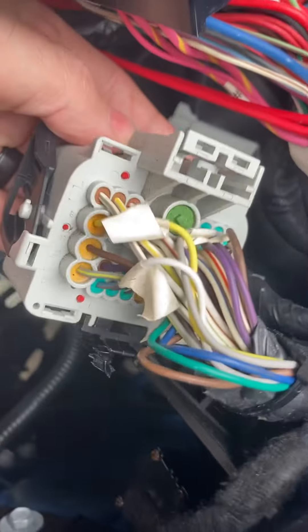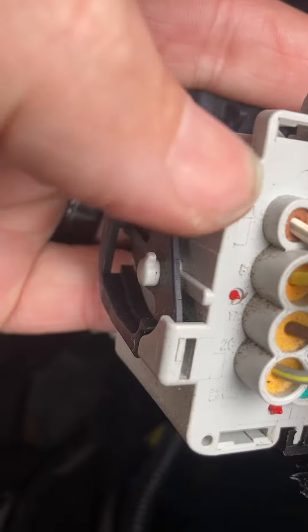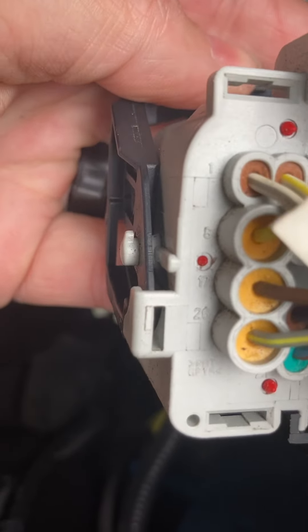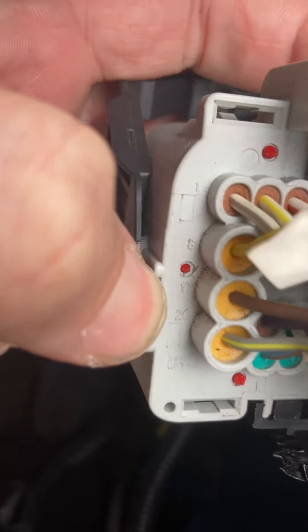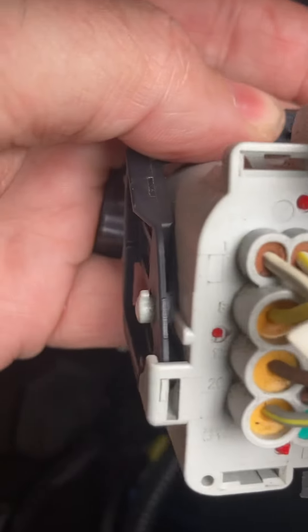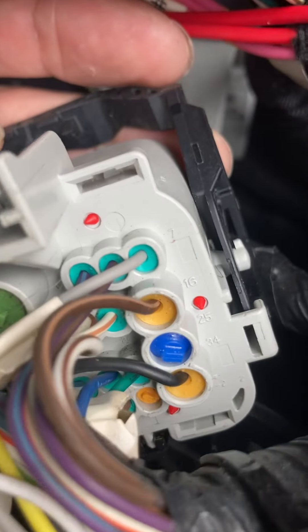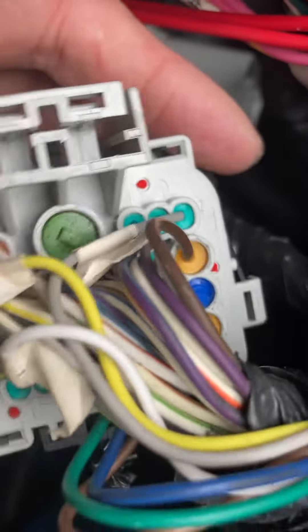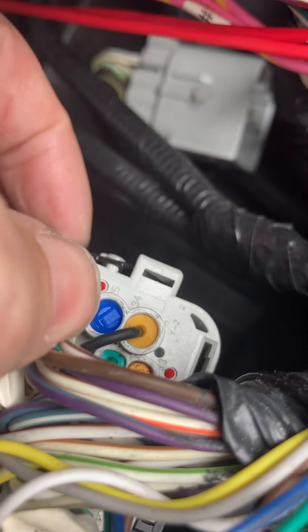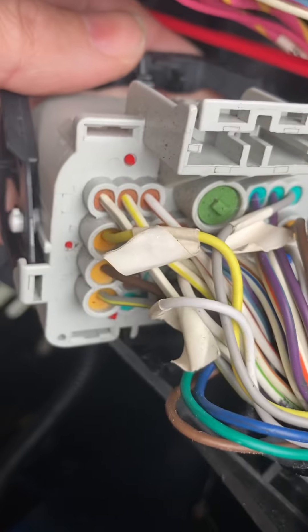On one side of the harness you'll already have the wiring, however the side where the wiring runs to your headlights you won't have it. What you need to do is unlock this connector to pin the six wires in my harness. Once it's separated, you've got the front half here — there's going to be a little locking connector right in the front of it. You'll have to pry up on it and pop it out using a little pick tool — it'll pop right off.